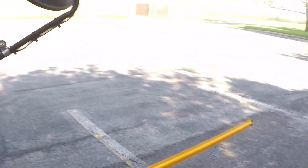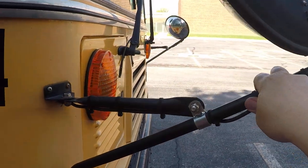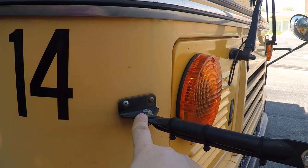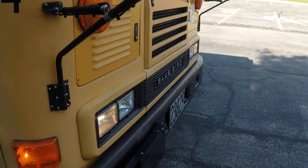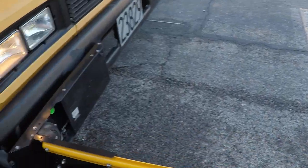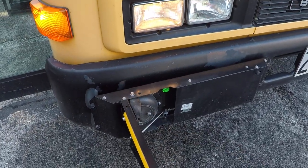We're going to meet our instructor outside the bus. First, start with our mirror brackets by shaking them — no loose or missing screws or bolts. Topside, check our stop arm: it's not broken, and our bladder isn't leaking.